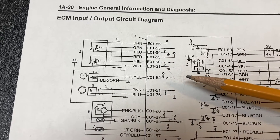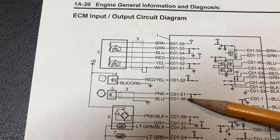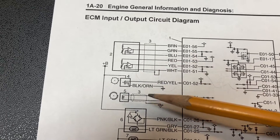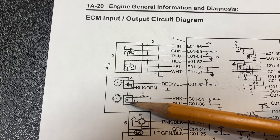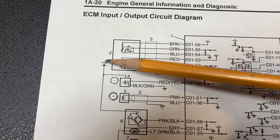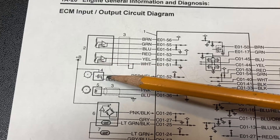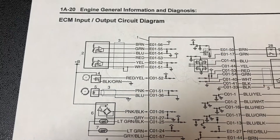There is also a crank position sensor on the SX4, but it's an inductive type sensor — not hall effect. Strangely, Suzuki have gone with two different types. We'll only look at the cam sensor today. So the three wires are: a 12-volt supply, an internally regulated 5-volt reference which is toggled to and from ground by the hall effect sensor, and of course a ground.